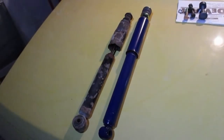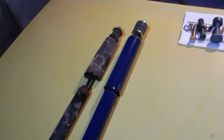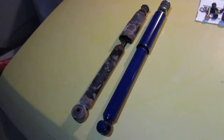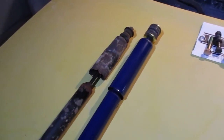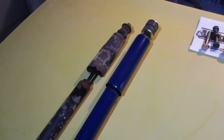Some of you might be thinking: now that we're putting a two-inch lift on, what are you going to do about shocks? Well, you've got old ones that are probably blown out or rusted out — completely junk. There's a simple, easy, cheap solution. I personally run a 95 Crown Vic shock on the right. I'm sure there are probably other years that will work, but I just give them the generic 95 year. It's pretty good for just a normal person — I have one on my woods-only tracker.